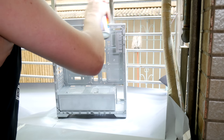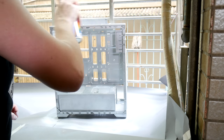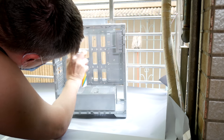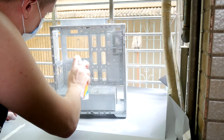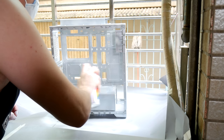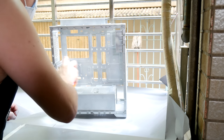This is the second time I'm painting with white, and white spray paint is difficult to work with since it shows the colour underneath. Don't spray white over black, as it takes 5–6 coats of paint to make it look really white. Using grey or grey primer first, the result is much easier to achieve with just 2 coats of white after the grey fully dries, with minimal touch-ups.